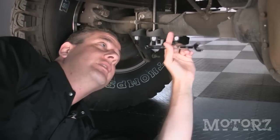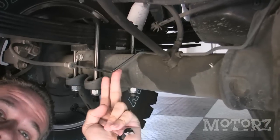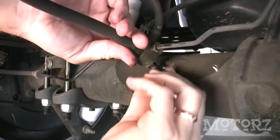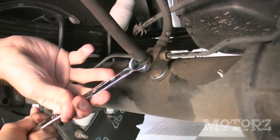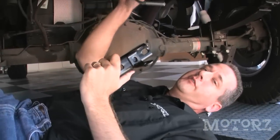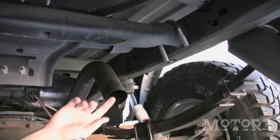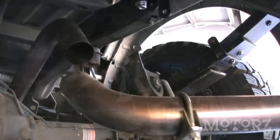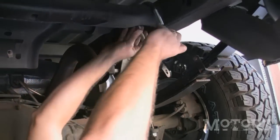We're going to start at the rear axle. This vent tube needs to come off so we can put a washer underneath it — that gives enough clearance for the U-bolt. Next, we install the U-bolt and saddle bracket over the crossmember for the spare tire. Hellwig recommends removing the spare tire first for ease of installation. Since the exhaust on this truck is aftermarket, we also needed to remove it temporarily — we'll have to re-work the exhaust to get around the sway bar once it's all installed.